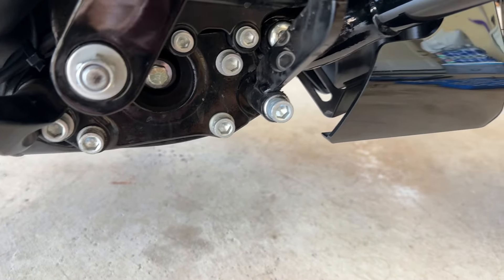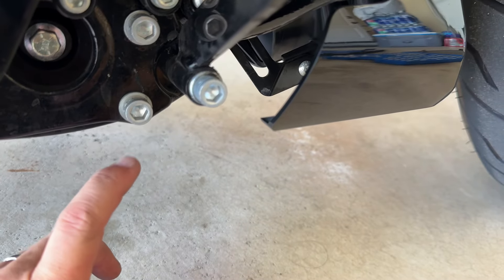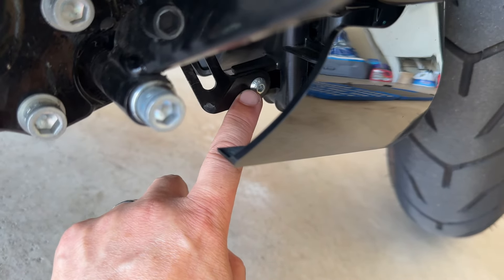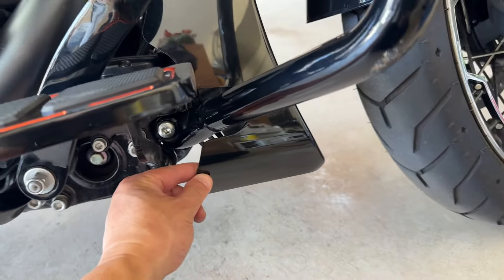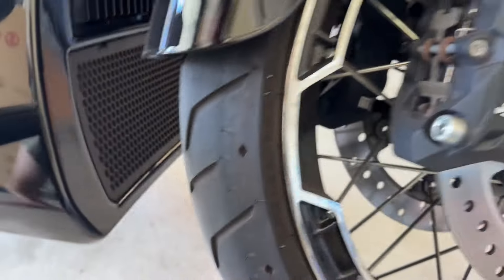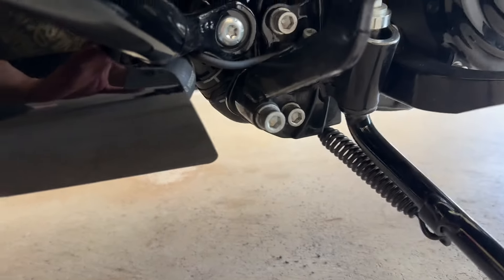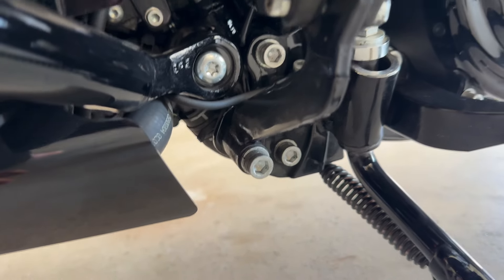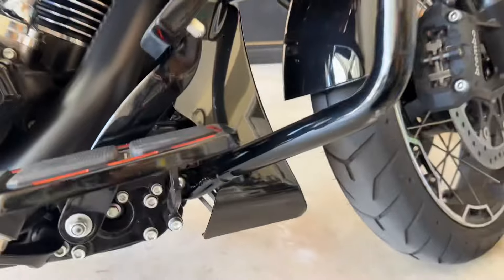This plate will mount to three bolts — two on the right side and one on the left. These are the bolts I'll need to remove and then reattach. There's a smaller one a bit farther in, and I'll need to remove the radiator cover to fully access it, and then one on the left side of the bike. I'll go ahead and remove all those bolts and then thread them back in using blue Loctite to make sure they don't vibrate loose.